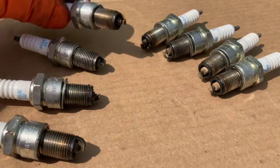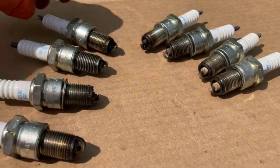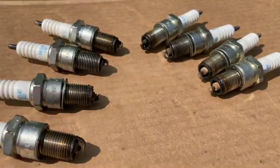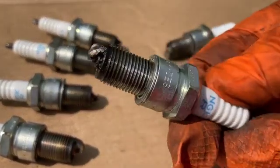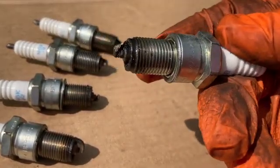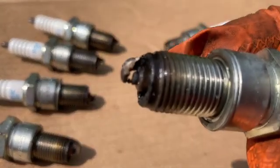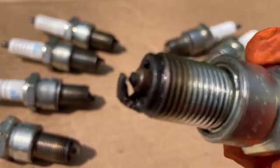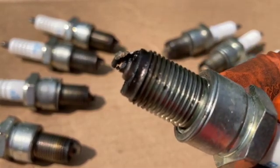And ironically enough, cylinders five, six, seven, eight were the worst on this one. And lo and behold, this one was the real troublemaker. Let me see if I can zoom in. See that? There's oil. There was so much junk that it finally bridged the electrodes.